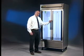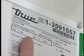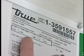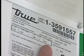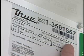You can get the information required off of the serial number on the inside of the unit. The model and serial number plate, located on the inside top left corner of the unit, will show the voltage and the amperage of the unit. Also, this large number here is the serial number that's necessary for any warranty or service claims.